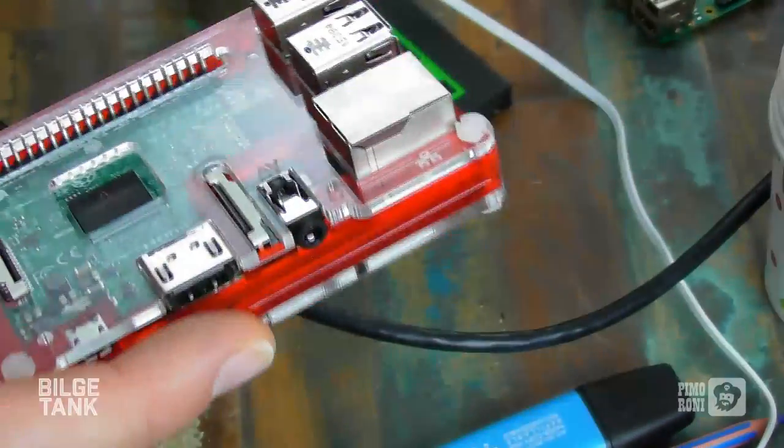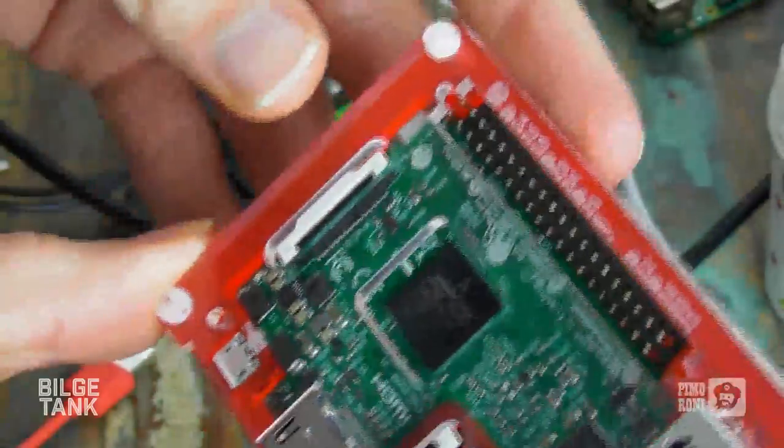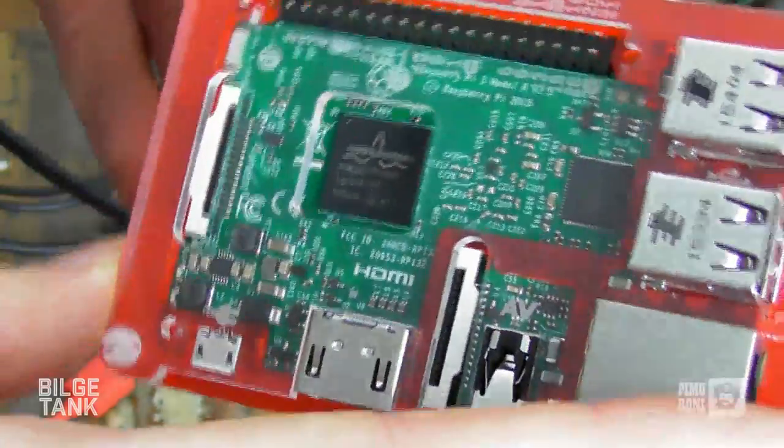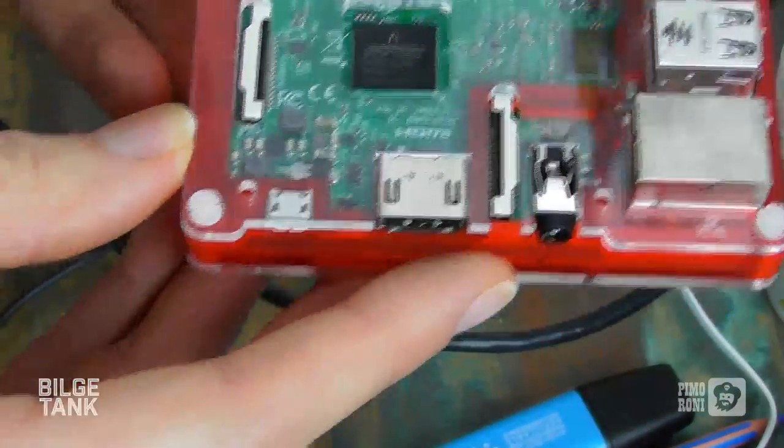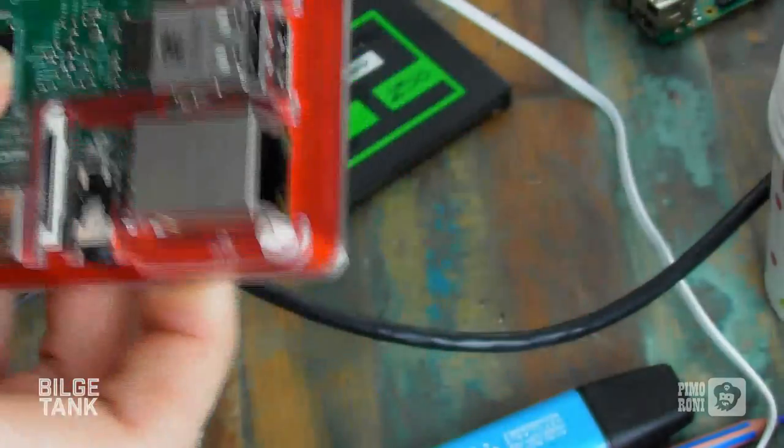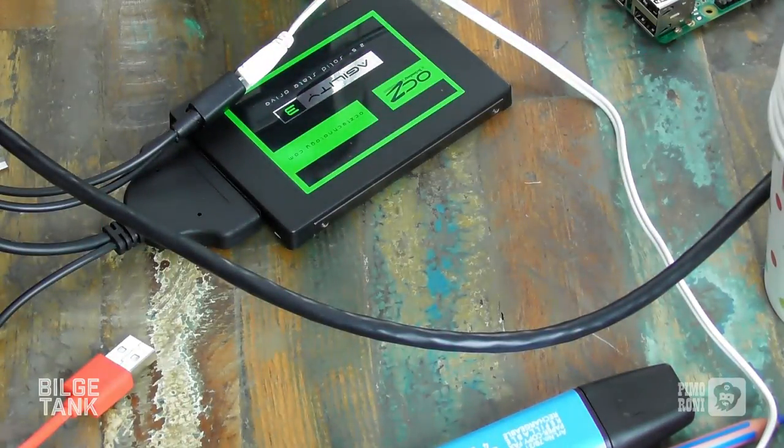It will just start to slow down the clock frequency as the temperature exceeds 82 degrees. But there's no problem with that. It's just to take care of the processor. Sticking a heatsink on is what you're going to do once you've exhausted all other possibilities of squeezing performance out of the Pi. Running your 64-bit ports of emulators at max CPU clock, or really inefficiently mining bitcoins. Whatever you want to do.